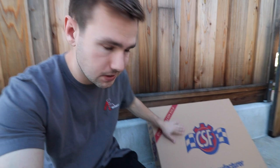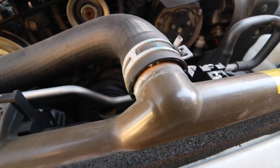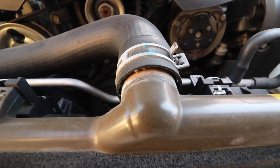Recently I did an oil change, and now I'm going to be replacing the radiator with a new CSF OE radiator, because the original one is starting to discolor and the end caps look like they're starting to leak a little bit, so before it kind of explodes and I get stuck on the side of the road, it's probably a good time to replace it.